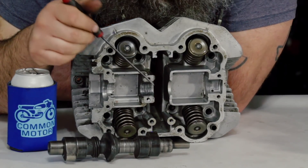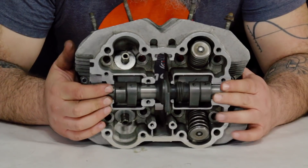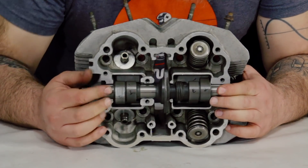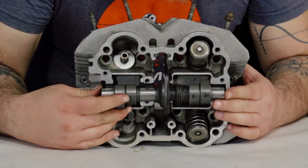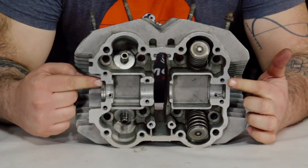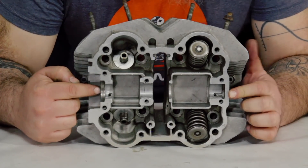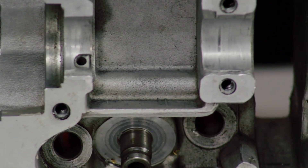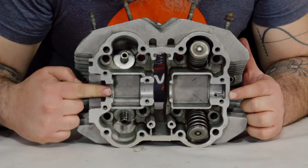Here is a clean cylinder head — this one is actually off a CJ360, a later casting. I'm just holding the camshaft in here. Here's our center cam journal, the one that fails. I'm going to remove the camshaft and point out an interesting detail. On the outer two bearing journals you can see the oil hole that provides oil to the end journals. But the middle has no oil hole. If we look closely in this little cup here, there's a raised part of the casting — this was a provision that Honda actually cast into the cylinder head to potentially be drilled and send oil from this journal over to the center journal.